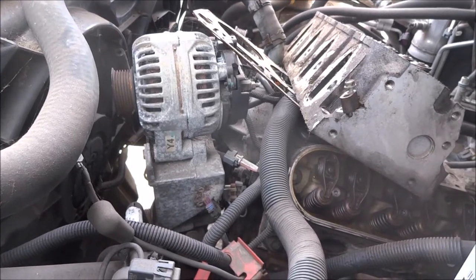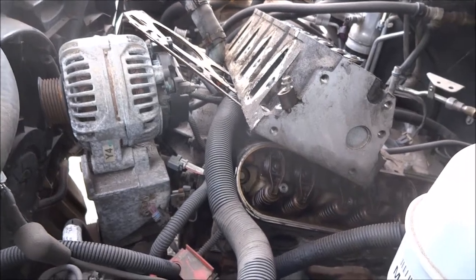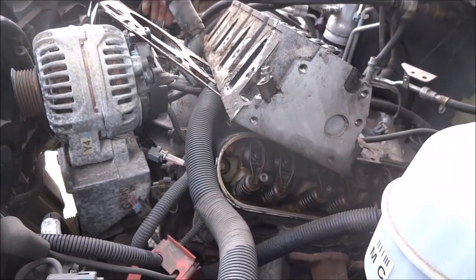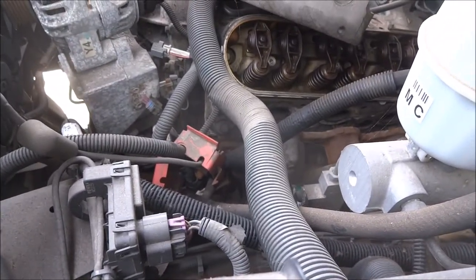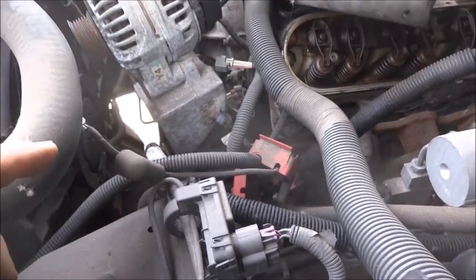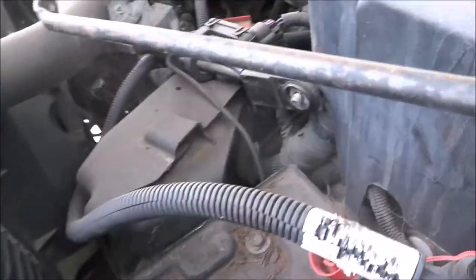Oh really? That's the theory anyway. Basically it just wears out the alternator. So she's going to need another alternator, water pump, tensioner bearing. Don't see an idler, but there's probably one in there somewhere. There's one down there. No, that's the power steering pump. You've got the power steering and the alternator on that. You're going to need a battery too. Probably an idler goes right here — that'd be my guess.